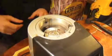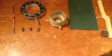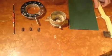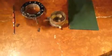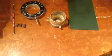And voila, we have cleaned the inside of the machine. So next thing now is to clean the different components before we put everything back in. Now the spring, there's going to be a little bit of dirt. I would suggest to just lightly brush it. They're steel, so it's better to always use the same type of metal brush to clean the components. So these being steel, we use a steel brush. If it was brass, we use a brass brush.